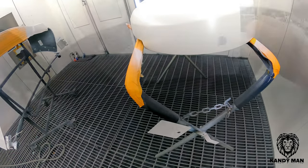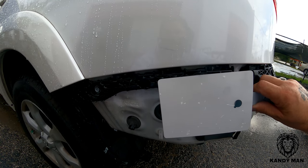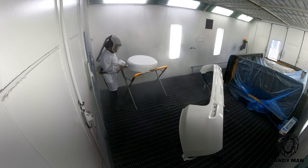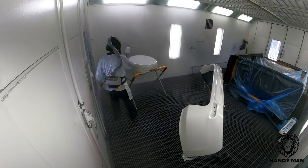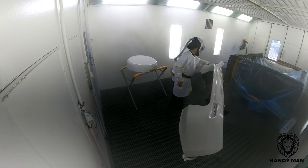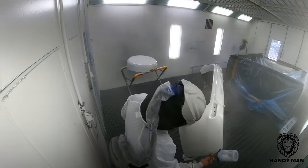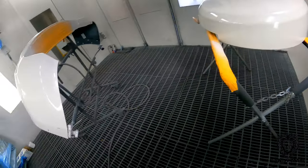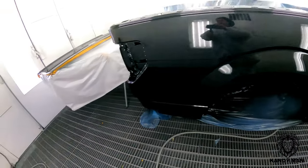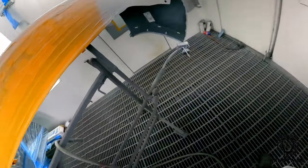We're still in the ballpark — you can see that matches really well. We'll put the bumper on it and check it. It's all cleared and came out nice. We'll unmask it now and get it on the car. I also shot this one in here — we did a new bedside and a tailgate. I like to get as much in the booth as I can, so this is a good load. We'll let it bake, unmask it, and try it out on the car.